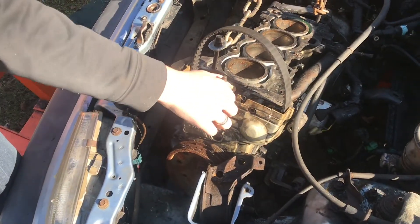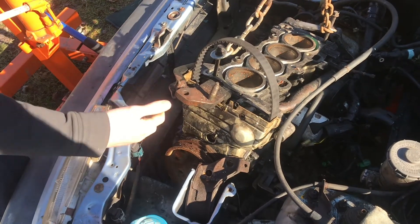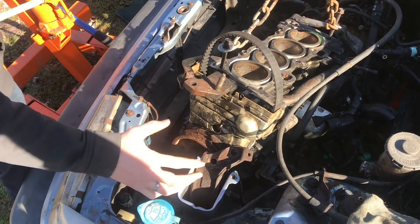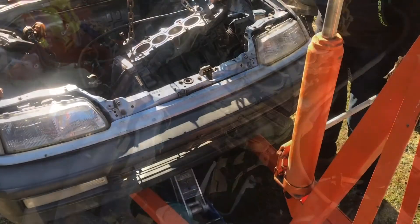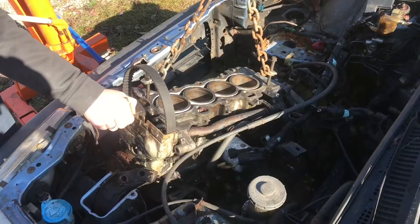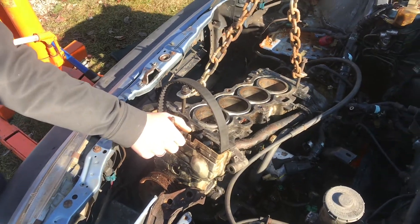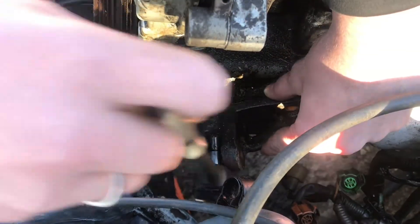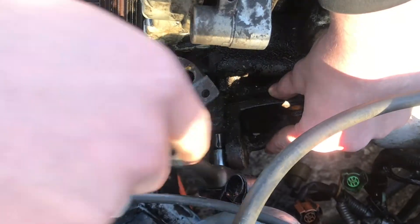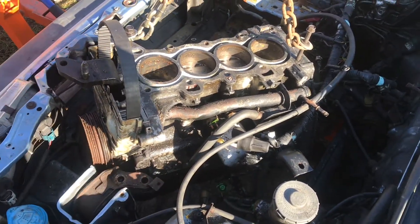As we're pulling this up, we're just gonna kind of move it around, make sure everything can move, and wiggle away from this motor mount here which is kind of spring-loading it down — so whenever we pull it up it's gonna pull up and over. It's feeling pretty free right now so I'll keep going up a bit. The alternator mount is hitting the motor mount so we're gonna just remove that, which gives us a lot more room and this can come out straight from this motor mount a lot easier.